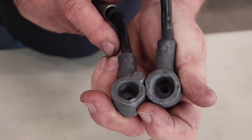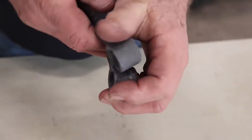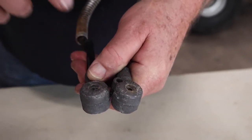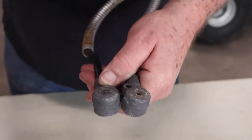If you're playing the originality game and you want original terminals, they're a lot of trouble because you've got to drill into the post. That'll snap a drill off — you've got to be so careful drilling it. Then put a screw down in there and get them real nice and tight, tightening the screw all the way down.